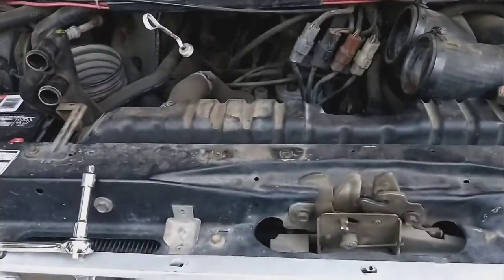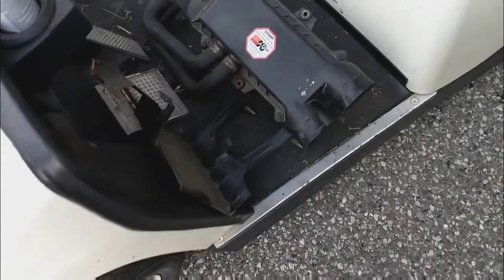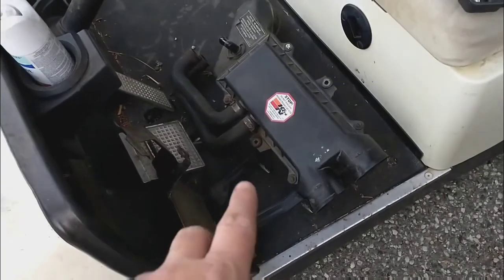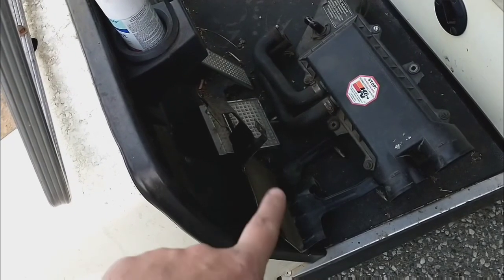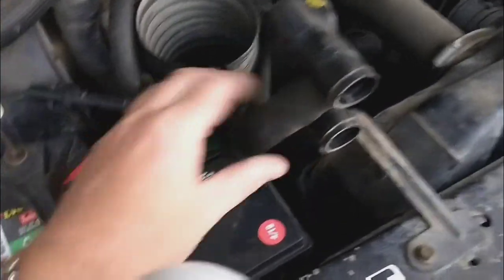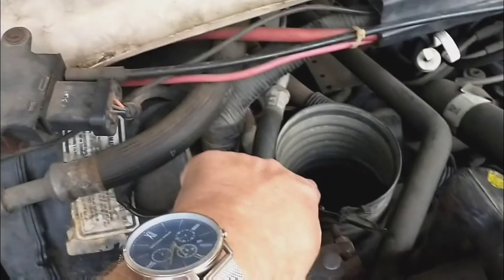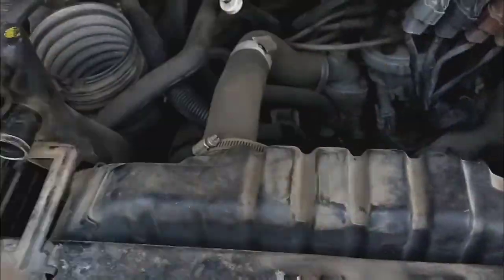Right now you can see it looks empty in there, which is great. First I had to take off all that mess — the air shroud. I took it off in two pieces; you don't have to do that. There's a bracket you have to take off — just take the bracket off and keep the shroud attached to it. Then you have to pop off this big hose and these big monstrous hoses as well, and then pull it out. That finally gives you access to your engine like any other engine would.